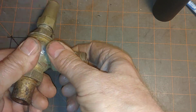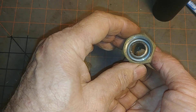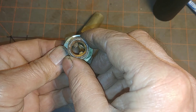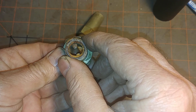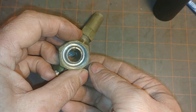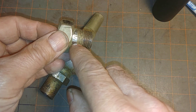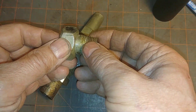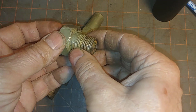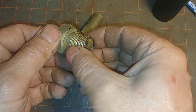You've got your half-inch spud — that's what threads inside the radiator. The typical lugs; these are fairly large, meaty lugs, and a standard nipple wrench probably won't be able to get in there to get those lugs without some modification. Here it was removed using the skinny vice grip technique, which I've got another video on. That's part of the reason why we want to get some of this stuff out rather than just merely cutting it out and boogering it up.